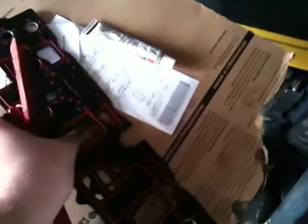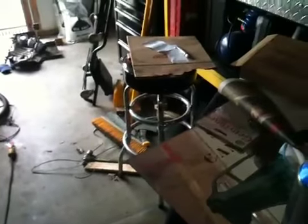She's all cleaned up and ready to go on as soon as I get the proper gasket. I can't use these — these are the ever-famous failing stock style. They're plastic. Plastic has no place in an engine, I don't care what anybody says. I might be a little old school — I like my big blocks — but there's no need for plastic in a motor. My wife's car is an old Grand Am and it's got a plastic intake manifold. That's just a vacuum leak waiting to happen.